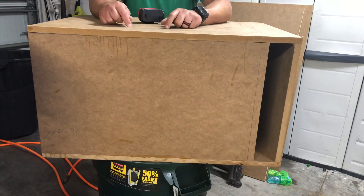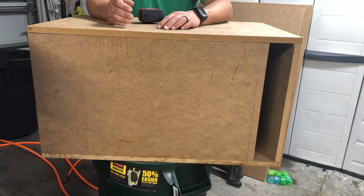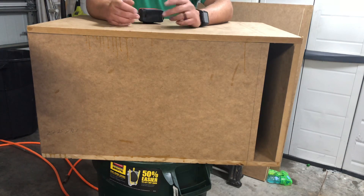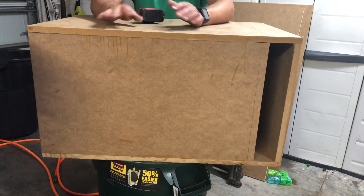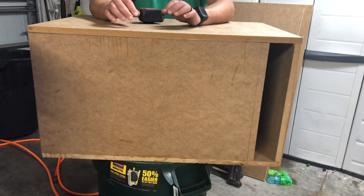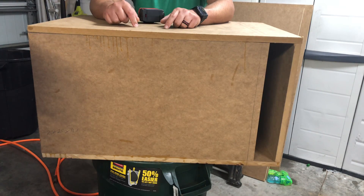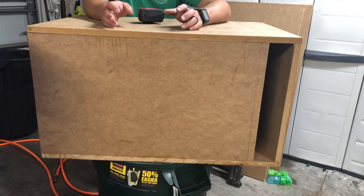This box is tuned to 34 to 35 Hz, depending on your bracing, sub displacement, whether you have one or two subs, and the number and size of 45s — all of these will change the air volume. This is a basic tuning box. If you plug these dimensions into Kicker, Rockford Fosgate, RE Audio, or WinISD calculators, it's funny because some will give you the same cubic foot measurements and some will give different results, and they'll also give different tuning even with the same parameters.